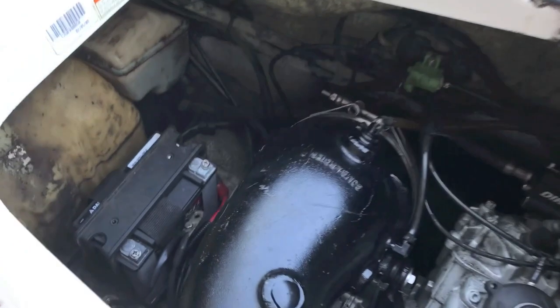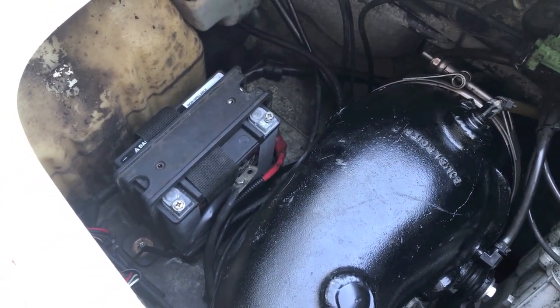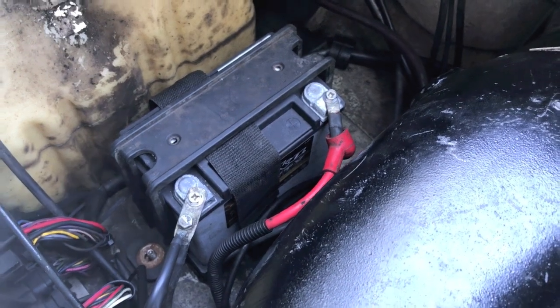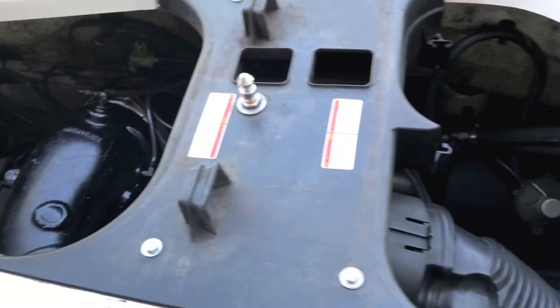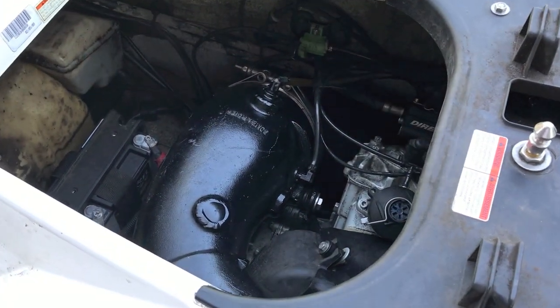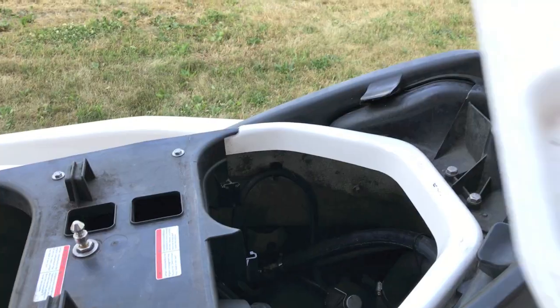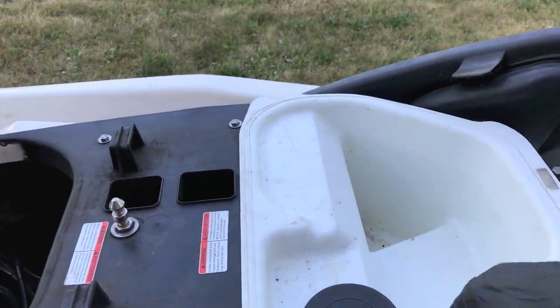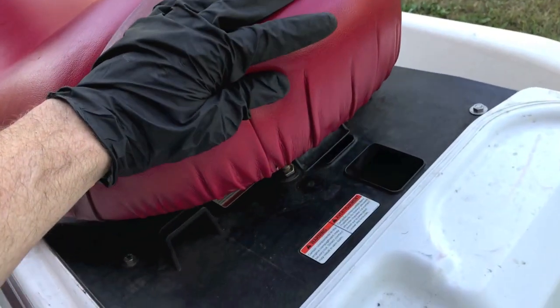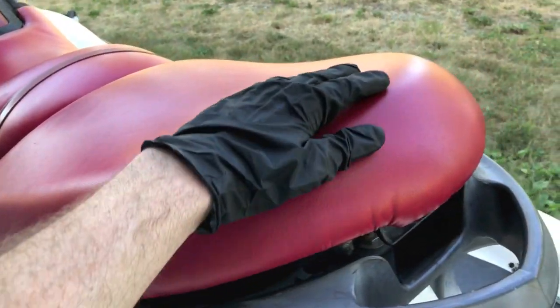From here let's reconnect and secure the cables — both negative and positive — to the terminals. Both cables are re-secured. At this point do a thorough inspection of the entire hull and all around the jet ski where you were working. Grab all those tools and make sure no tools are left behind in the hull. Grab the rear plastic cover, re-secure that, reposition the front seat and secure it on the actual prong — you'll hear a click — as well as the rear seat.